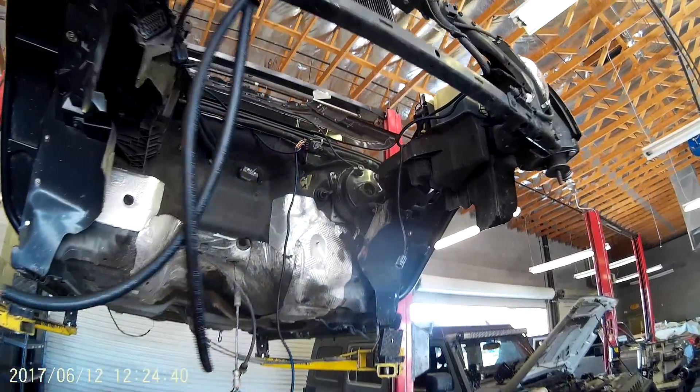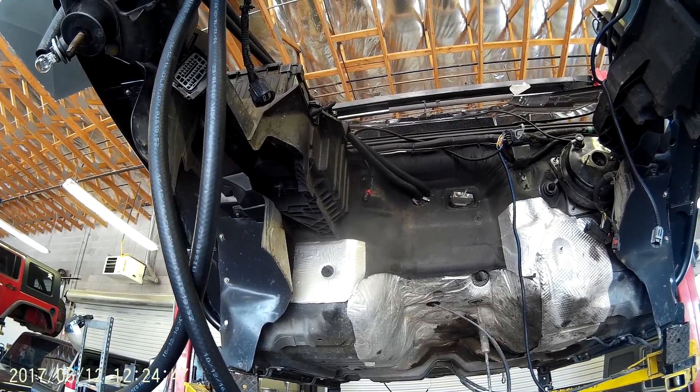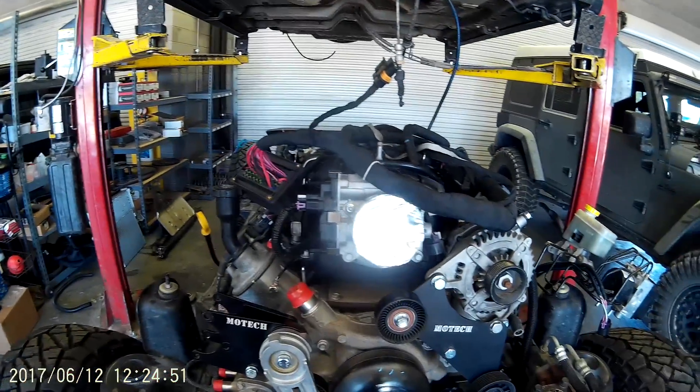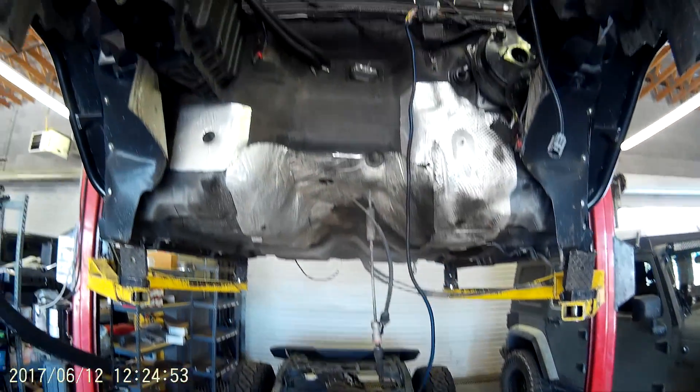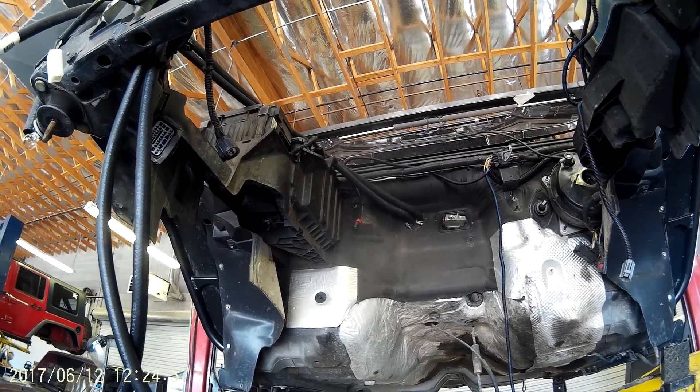You can see they have the body prepped here. We've got our heater hoses on. You'll notice those heater hoses have 90-degree bends on them where they go up against the firewall. You want to do that with these truck motors because of the tall intake. I like to run them right up along the battery tray and then down to the heater core — it keeps them up off the engine and out of the way.